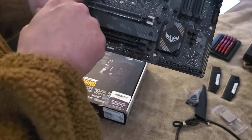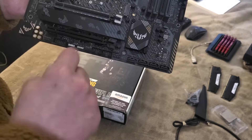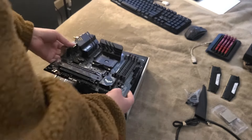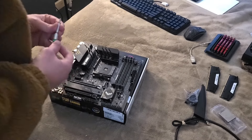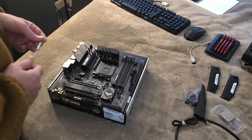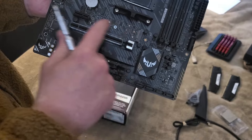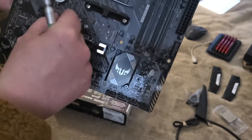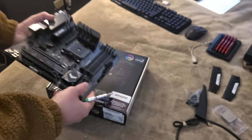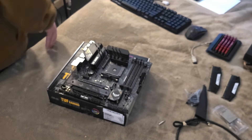There is another fan header - so this one here is for your rear fan, and there's another one down here. My case has two fans but I have a splitter running the two front fans, and the one in the back runs itself. The manual on this board recommends you put your NVMe SSD right here on the closer slot. It's weird - it even has one way over there. This size definitely doesn't fit over that spot, so you just grab a little tool.